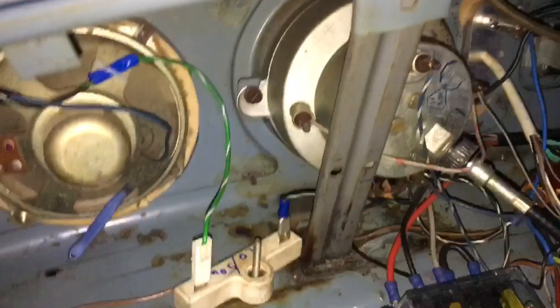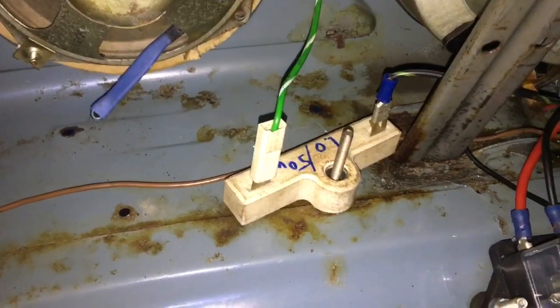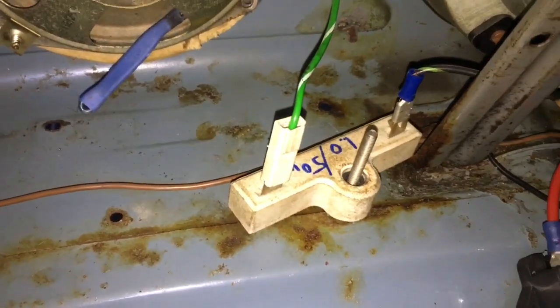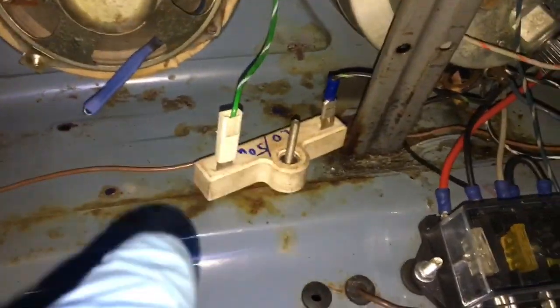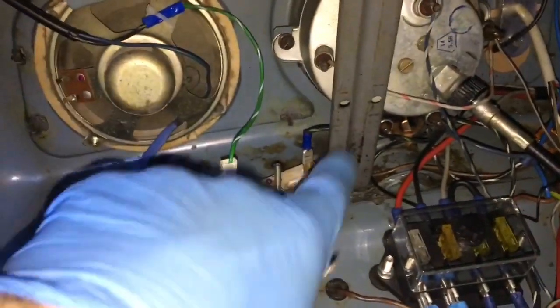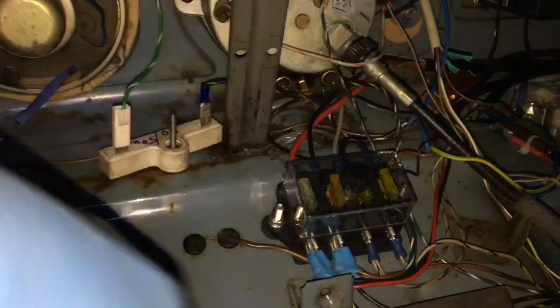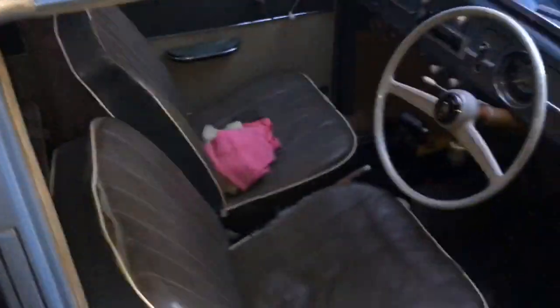Here she is — quick look inside. This is just a quick bodge, remember. That's the one that works. Once I measured and checked it, it's 1.1 ohms at 50 watts. I'll be replacing that with the new gold one. This other one is just temporarily bodged in place. I'll get both mounted on a plate, support them properly, so it looks neat — left indicator, right indicator, screwed in nicely.